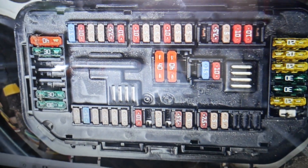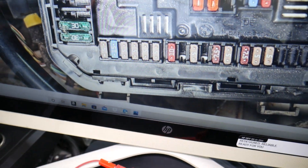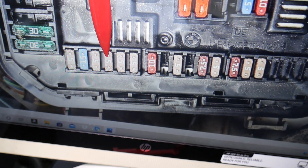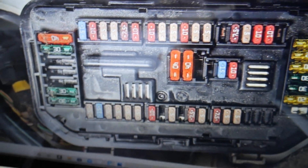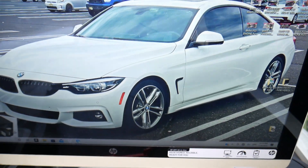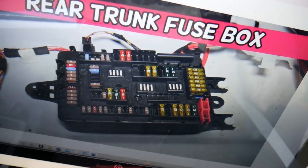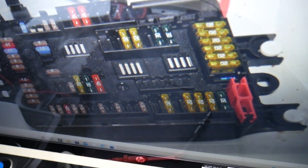After that, we go to a different fuse row — the bottom row facing towards the front. The first fuse there is number 42, so we need to check fuse number 43. Then we check fuses 45, 46, and 47. After those, we need to check different fuses in a different fuse box. We need to open the main trunk fuse box — remove the cargo liner in the trunk and you'll see a fuse box layout just like this one. Here we'll need to check more fuses.